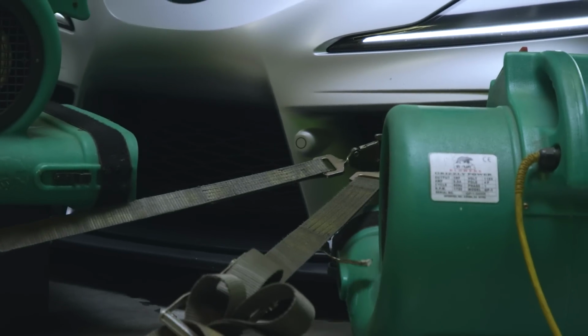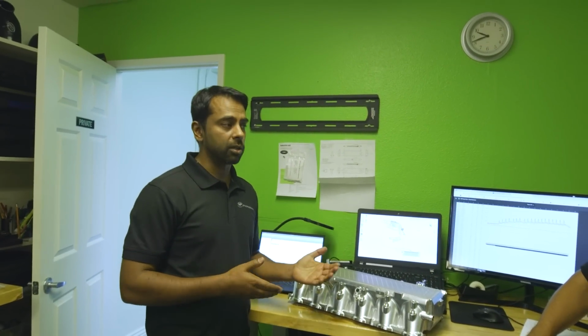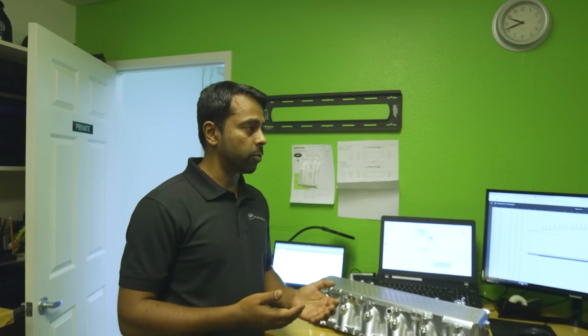The air circulation within our facility is also limited. So we were sort of strangling the car somewhat, but basically putting it through its worst case scenario. And the engine went into protection mode, and it pulled out about 40% of the power, right? It did. The dyno curves looked almost as if they were back to stock. And the car has our tuning software and a performance exhaust, and that was with the stock setup.